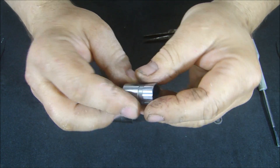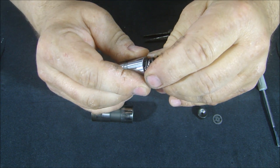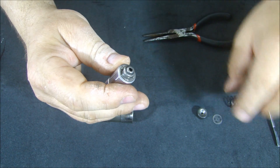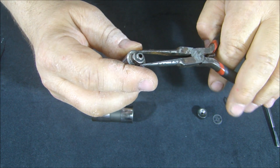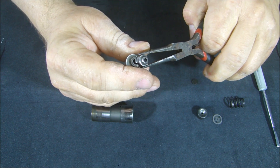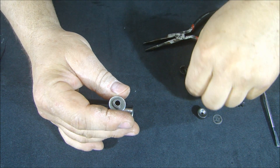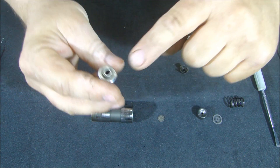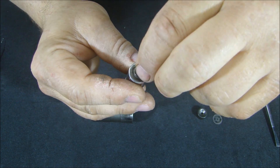That's what gets pumped up to the top. On the bottom you have this check valve, and this is what bleeds down. Take the spring off gently, and you have this assembly. Underneath is another spring and a check valve. That little thing is the check, which sits against the orifice opening. So the check sits against that and gets pushed against the bottom.